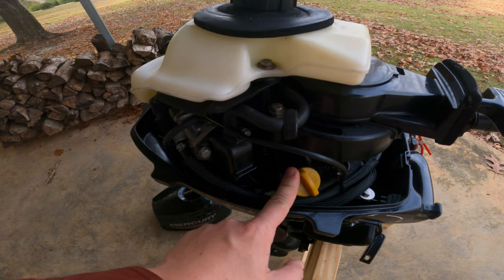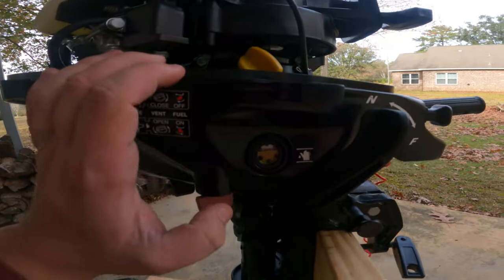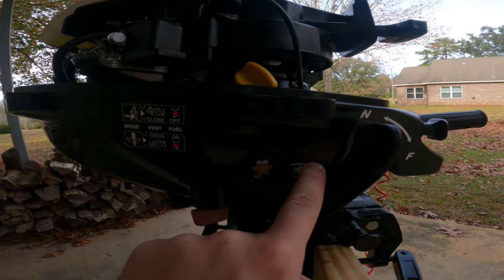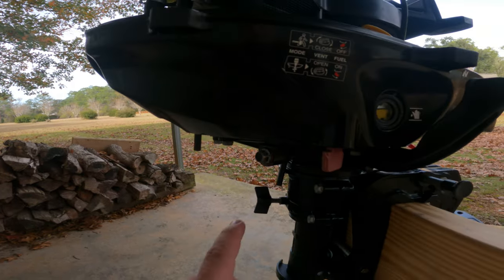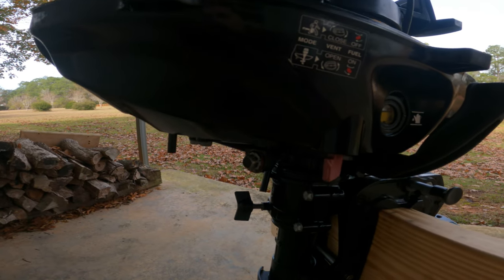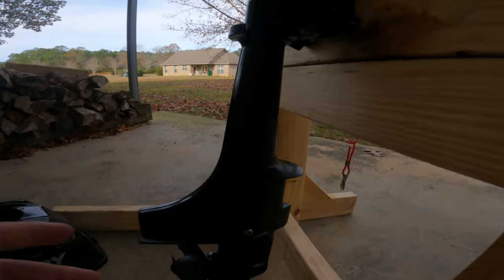For oil, you fill this cavity right here. You do not have a dipstick — instead you have a viewing window on the corner, and you can see the oil level right there at the top of that mark, so we are good and the oil looks really clean. When you need to drain the oil, it's a small 10mm bolt right here. Just get a small catch pan — it takes 300 milliliters.